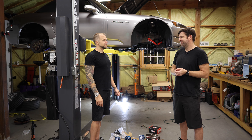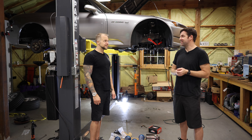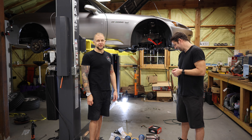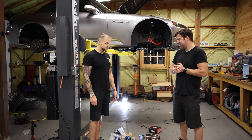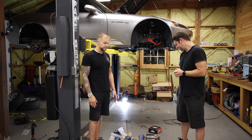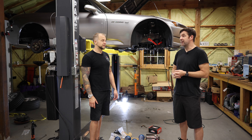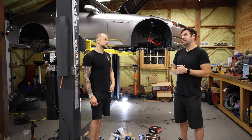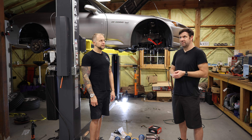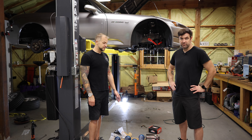The fronts were three pounds each — six pounds of weight savings in the front, and then the rears are 2.6 pounds each. That's crazy. 11.2 pounds of weight savings just by switching the coilovers. And we're adding helper springs to these too. The Blade Sports have helper springs. So kudos to Blade for making them very lightweight. I appreciate that because I like everything as light as possible without compromise. I'm pretty sure the Tane's are lighter than the OEM — I didn't actually weigh them back to back, I just assumed that because usually coilovers are lighter than the factory components. But S2000 has some pretty trick stuff, so maybe they're not. Either way, this is a weight savings that's just awesome.